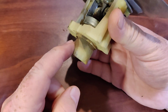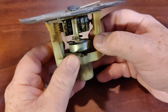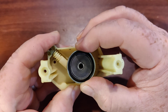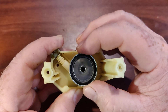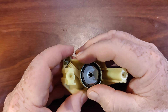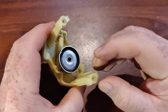These have an older style shaft or bearing in them that just gets worn out. You can tell by shaking this back and forth — it'll be loose. See how much play that has? I've seen ones that are even worse than this. So if you can do this with your screw-in style speedometer, that could be why you're having a needle that's bouncing all around. Eventually it'll catch, and it'll just spin and break the needle and break the little spring in there. That's the main reason these go bad.